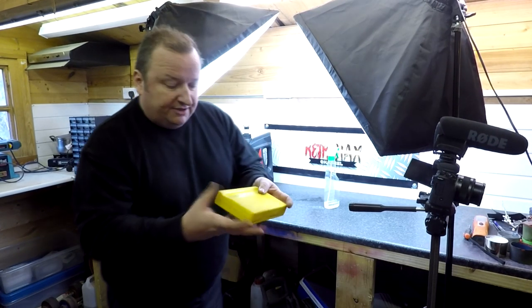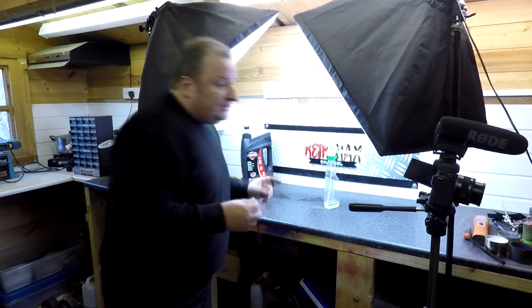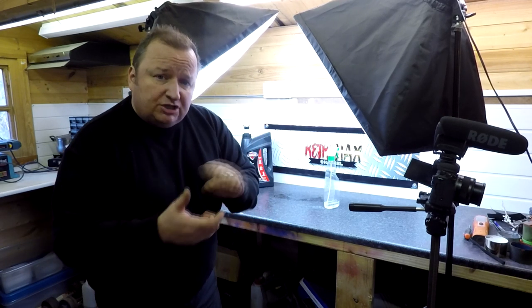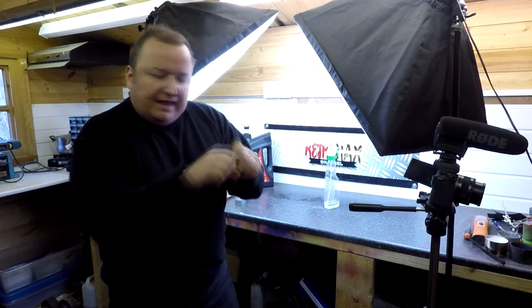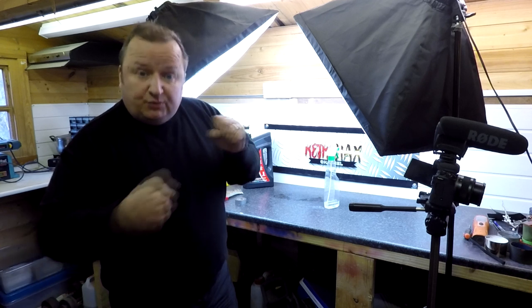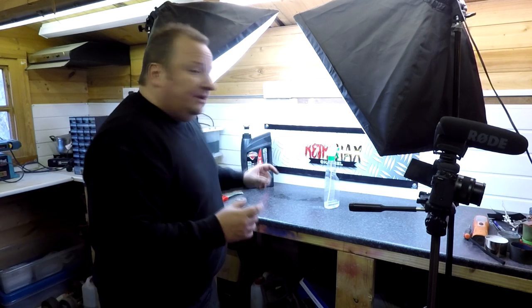And they're also very easy to keep clean, so that's another benefit of these little spray guns. It's actually a lot easier to spray with one of these, I find, than a normal spray gun, because you've got less chance of getting runs. If you do repairs on something and it's only a small item, one thing I found when you're using spray can paint is that it comes out so fast, that's when you get your problem with the flooding and the runs and all that. This is utterly controllable, and it's a lot more smaller scale.